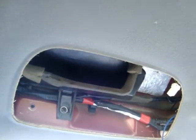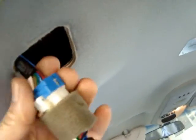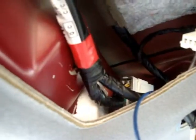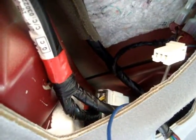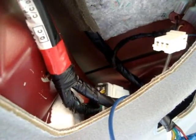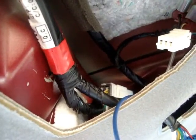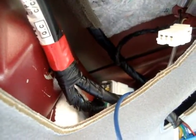You can get the yellow wire from the air vent or air duct right here, which I did initially. If you have a live wire from your air vent, then you could use that for your yellow wire. In my case I didn't have one, so I had to go underneath the seat and find a wire that has the live current that is always on. I found my source right here.